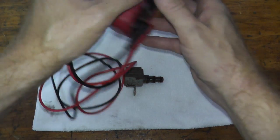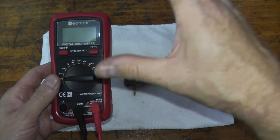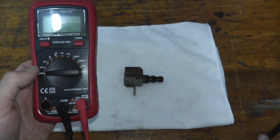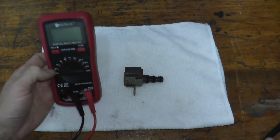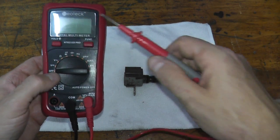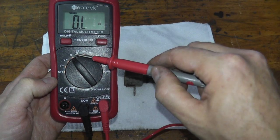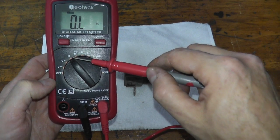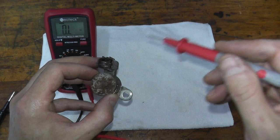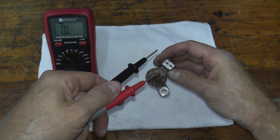So how do we test this sensor? We'll be doing two separate tests. This is known as a digital multimeter — a very important and fantastic tool to have if you plan on doing your own auto repairs. I'll include a link in the description box to Amazon if you need one. You have a number of different functions on the multimeter; in this case, we need the ohms or resistance setting, displayed with the omega symbol. Inside the valve here, you have two prongs.